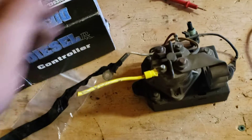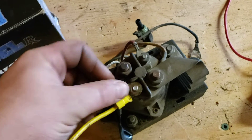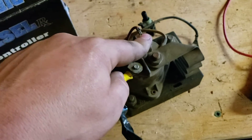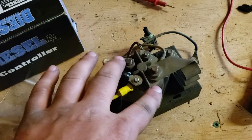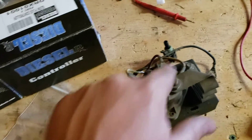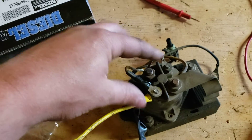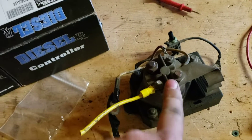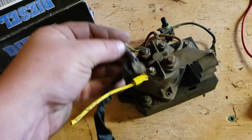This signal wire is supposed to sit on that terminal. The way relays work is they use a lower amperage circuit to close or open the relay for a higher amperage circuit. In this case everything is 12 volts, but this is a lower amperage circuit and this is a very high amperage circuit. Without this wire here it's not a complete circuit — you cannot send power through the relay to tell it to function without this wire being connected. So I replaced it.